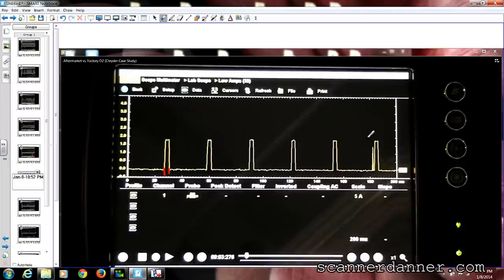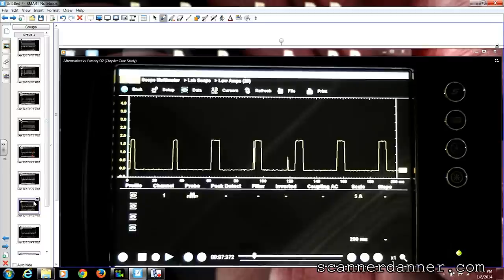I'm not worried about the spikes - I was seeing those even on the good one. Another capture of the Bosch O2 shows again 4 milliseconds here, 4 here, maybe 6 in the rest - so about 6 milliseconds of on-time. We can say 4 to 6 milliseconds of pulse width on-time for this O2.